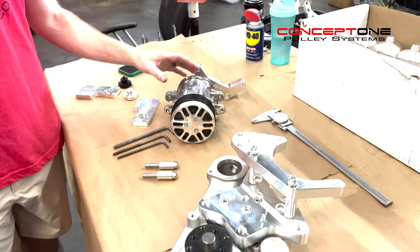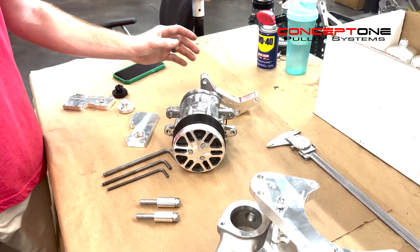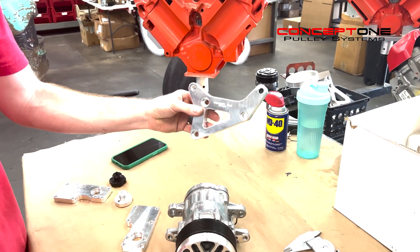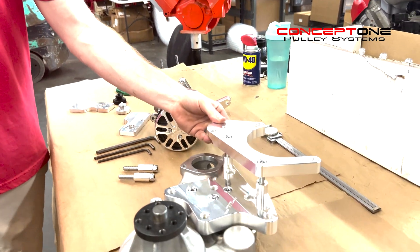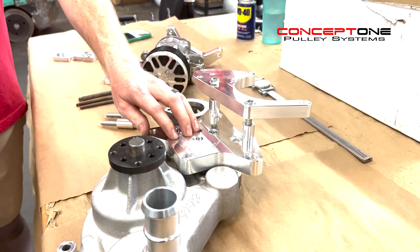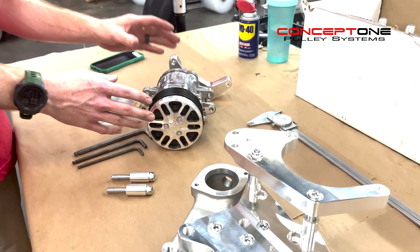This is our SD7 AC compressor. We use this AC compressor in all of our pulley systems. On our LS supercharged kit, we fit this AC compressor to our engine in the back with a one-inch thick main bracket. It is also mounted in the front with a three-quarter-inch thick bracket and another one-inch thick bracket bracing it off of our water pump and our engine block in the front. That secures this to our engine block in three different places.